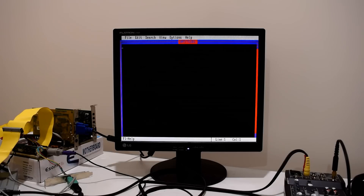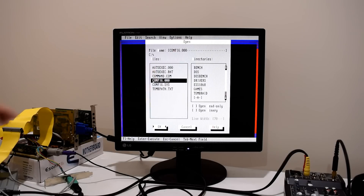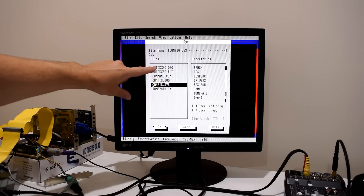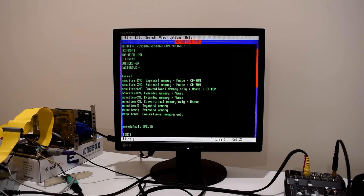So let's type in edit and open the config.sys file. It also backed up the old config files into config000 and autoexec000. All this does is turn on the IDE interface — so if you don't need the IDE interface on the sound card, get rid of it. Here you can type in the address: 168 was one option and the other one was 1E8. And here you can choose the interrupt — there are three options: A is interrupt 10, B is interrupt 11, and C is interrupt 12. You just have to try them out. In my case interrupt B and C froze the machine, so interrupt A worked for me.